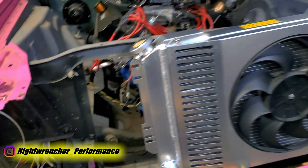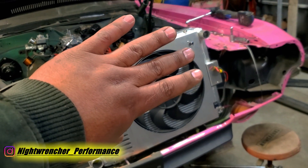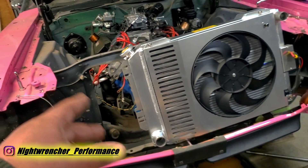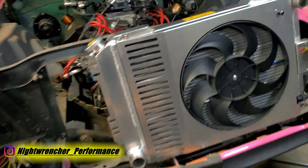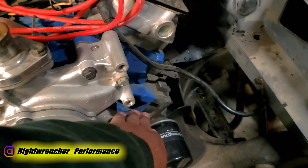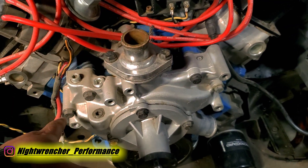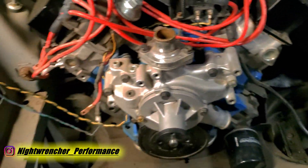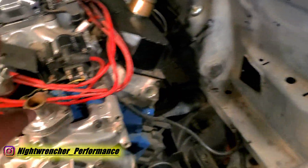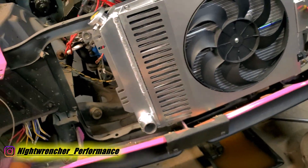That's just one of those things you have to look for when you're purchasing a radiator. There's actually an option to flip the inlet and outlet of the same radiator in order to fit a different combination. For example, there are some water pump housings for the same engine that exit on the passenger side instead of the driver side, and in that case you're going to have to run a driver side inlet. There are just a bunch of little nuances, so please pay attention when ordering your own radiators.